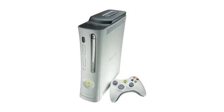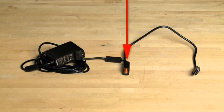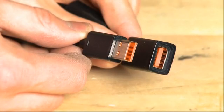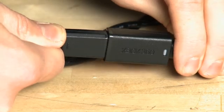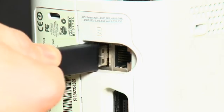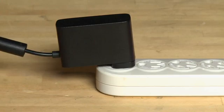If you have the old white or black Xbox, you're going to need a special power adapter which comes included in the box. On one end is a power supply, in the middle you have a converter for the Kinect sensor, and on the end you have a USB extension cable which plugs into the Xbox. This is the Kinect sensor next to the dongle attachment for the power converter — you just line up the ends and snap them together. Then take your USB extension cable and plug it into the back of your Xbox, and finally plug the power supply into any power outlet.